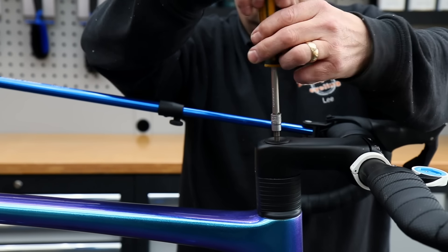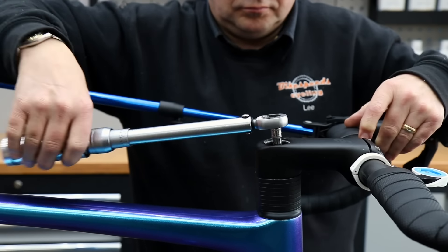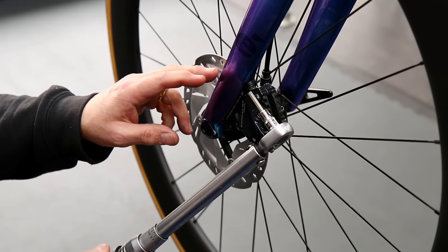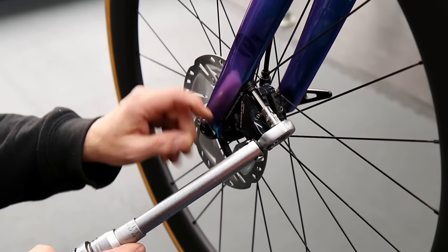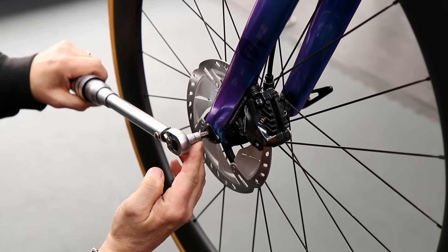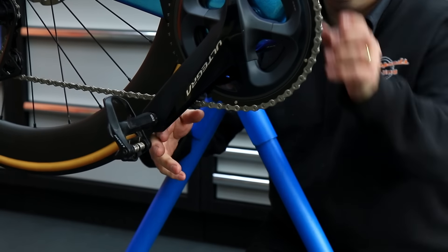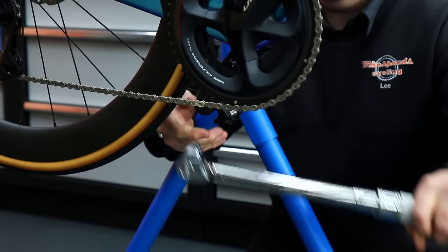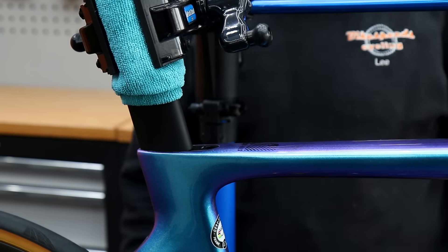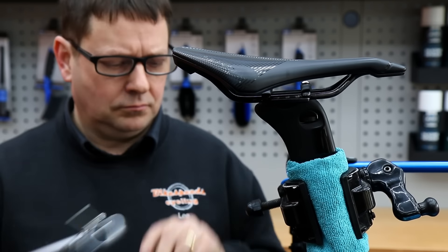There was also a little bolt inside this stem which was completely loose - I'm amazed it didn't have movement in that entire headset area and front forks, but that's now absolutely spot on. The front caliper was quite loose. I also torqued the through axles to their specification with the torque wrench - not just with a hand lever. Pedals, chain set, the seat post, the saddle clamp.